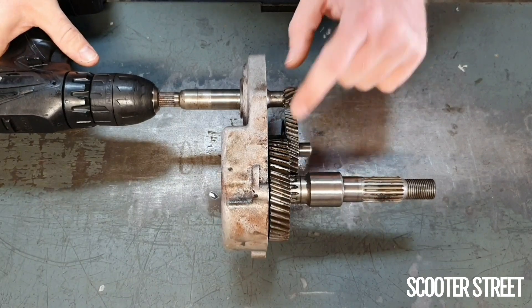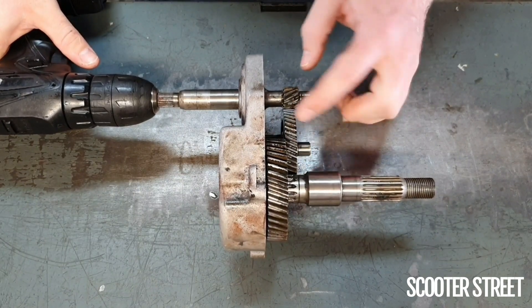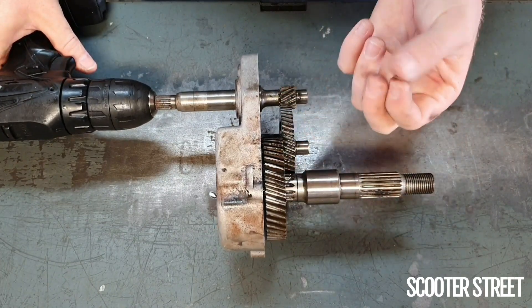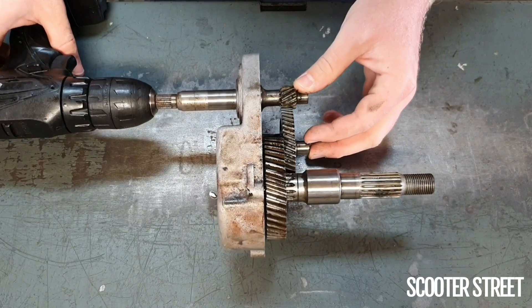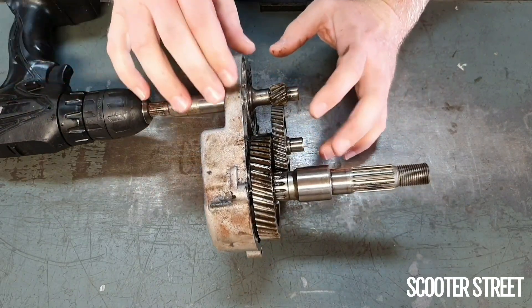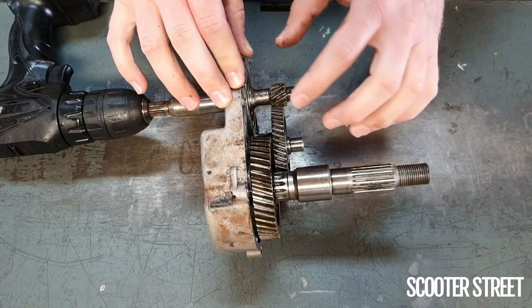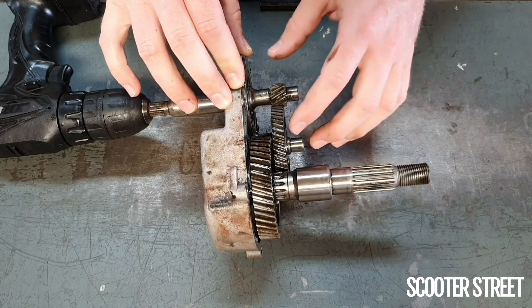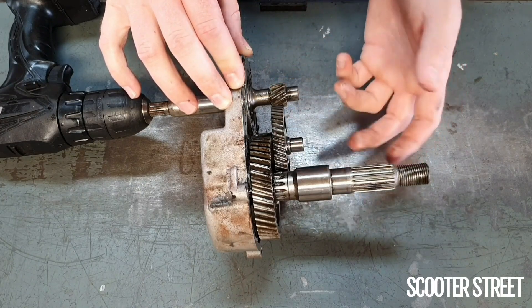You'll see there, these first couple of gears are turning quite rapidly, and then it's slowing down as it gets to the driveshaft. Now, you'll see this is quite dirty in here — this is gear oil. This is quite thick stuff, usually 80 or 90 weight, pretty heavy stuff. And the reason for that is these gears are turning quite rapidly. This is where gear oil comes in, and this is why we say it's really important to regularly change your gear oil.